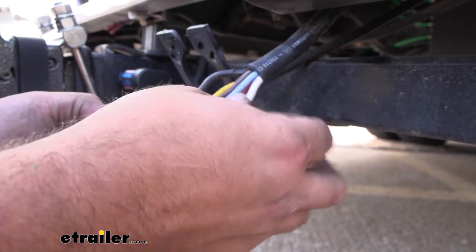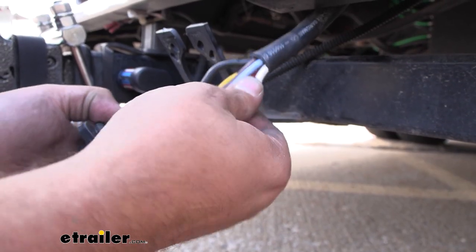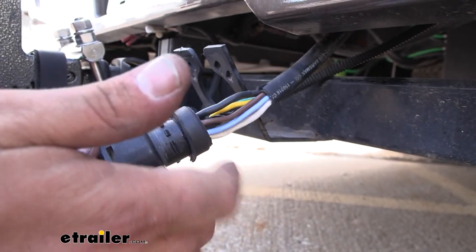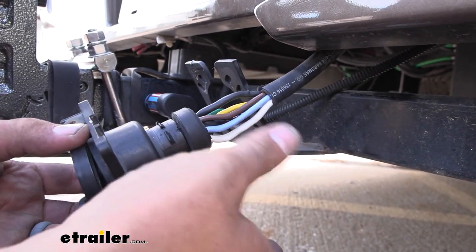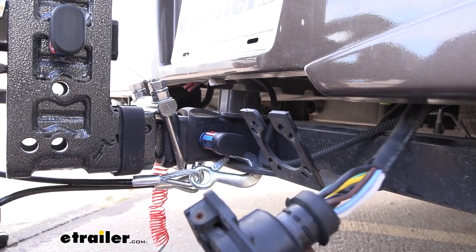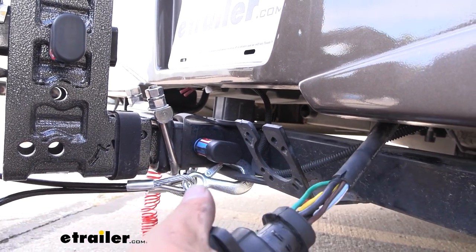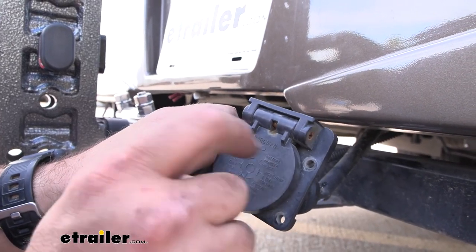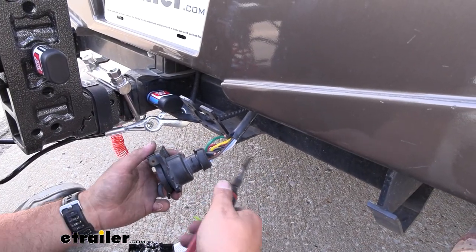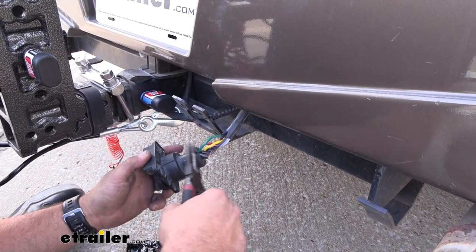Once you've exposed your wires, go ahead and cut them off, leaving enough to make our attachment point to our new plug. Before removing your old plug, you may want to note where each wire is going — maybe take a photo for reference — and then put your new plug in the same way. Don't go color to color because it's not necessarily going to be correct; you want to make sure it's in the proper position your old plug was in. Also make sure you disconnect your battery before cutting wires, because you can have 12-volt power going through these and you don't want to arc with your wires making contact with one another.